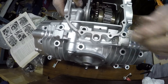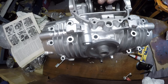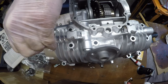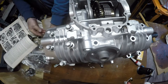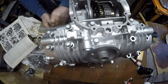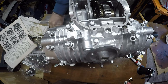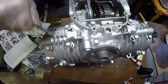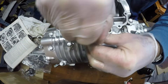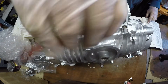A light tap with a rubber mallet helped ensure it seated correctly. Then fit the crankcase bolts - these need to be done in a certain sequence, so read the manual for the sequence and torque settings. I generally tightened them all finger tight, then nipped them up a little bit, then got the torque wrench out and went through two different torque settings following the sequence in the manual.